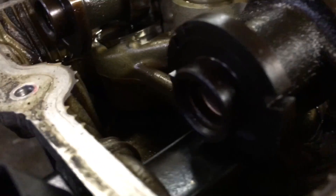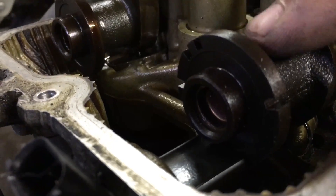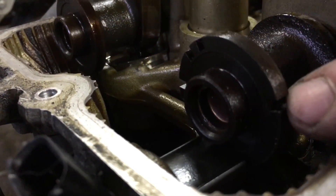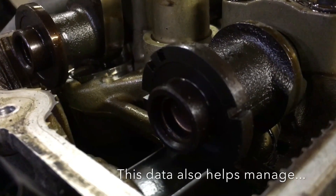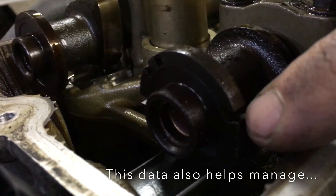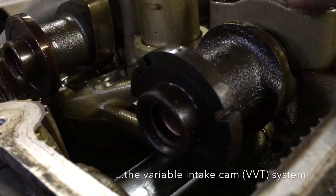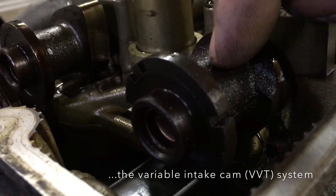— or you might even call them high and low spots on this metal disc, to pass directly in front of that sensor. The sensor can tell when there's either a high spot or there's a gap, and as it spins at thousands of RPMs, it can sense these blank spots. The computer knows by the variations in the signal exactly the position of this camshaft as it spins.